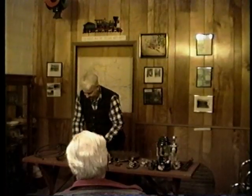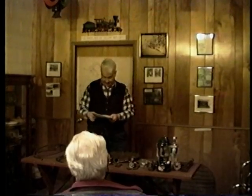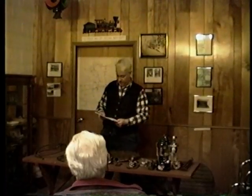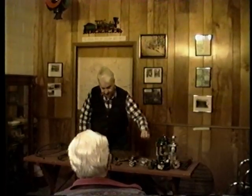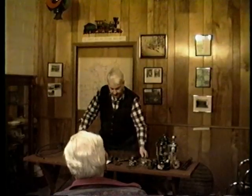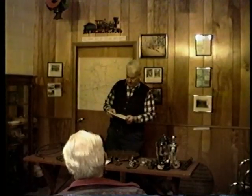So, getting back to my story here. The earliest cars had the single burner, and then about the time the coffin nose cars came up, which was 1905 or so, they went to a double burner, and that had two nozzles. This is the single nozzle type, and this is the double nozzle type. And then when the 30 horsepower cars came out, about 1908, they decided they needed another nozzle, so they put a triple nozzle.